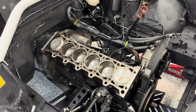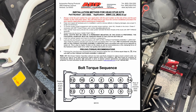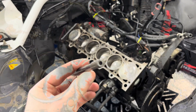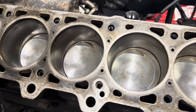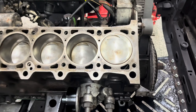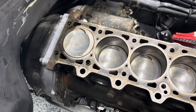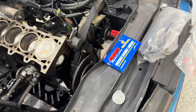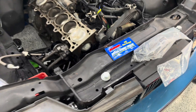I'll put the instructions for the ARP installation up on screen now if you want to read that. Basically all we're going to do is take the head bolts and inspect your threads. If any of them are damaged, ARP does sell a thread chase to repair them. None of the bolts will come in contact with coolant, so you can use Loctite like the instructions recommend for permanent applications. However, I'll be just using the fastener assembly lubricant that comes standard with these head studs.